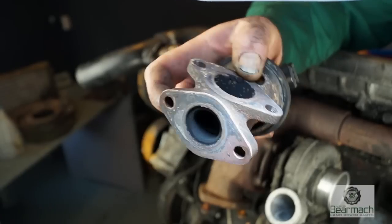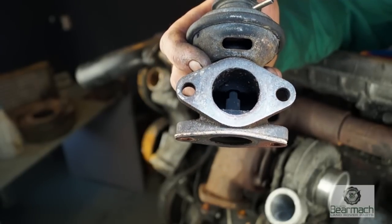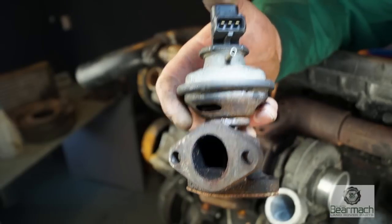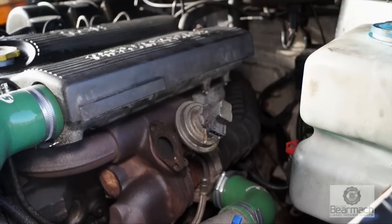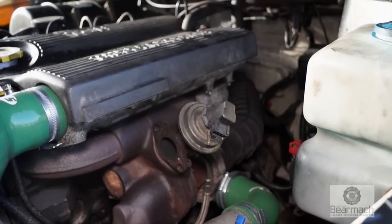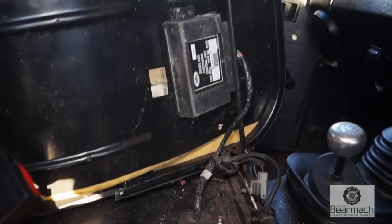Not a very good state to be in. You can see the valve in here — it lifts off when the vacuum activates and should suck a diaphragm and lift it off its seat. However, sometimes these also leak. Unfortunately, when you rev an engine you can see the smoke coming out — it will push the valve off its seat as well, which in effect makes a mockery of the electronics.